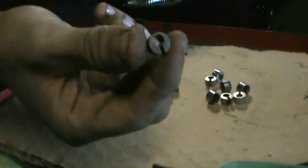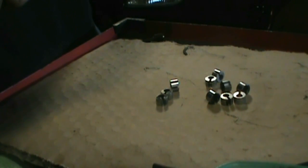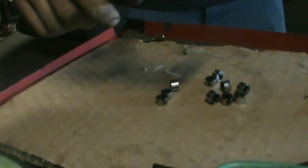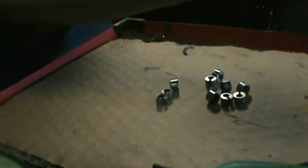If you're like me and you're cheap, you're reusing your corner seals, and it's perfectly fine. These don't really serve any load, but you can see in the service manual that they're anywhere from 6.8 to 7 millimeters, and mine are 6.88 millimeters, so they're still within spec, easily. They don't usually wear down too much at all, pretty much.